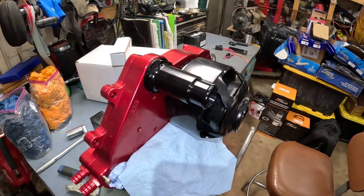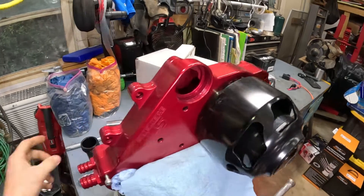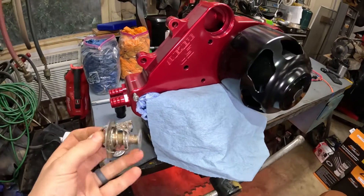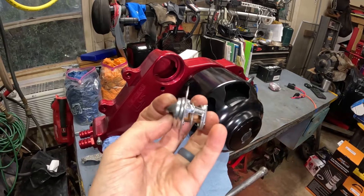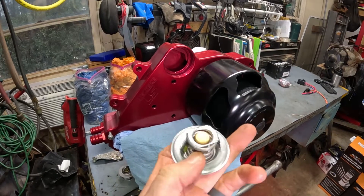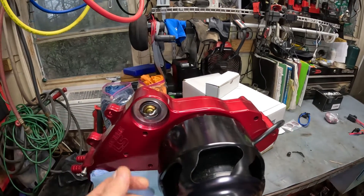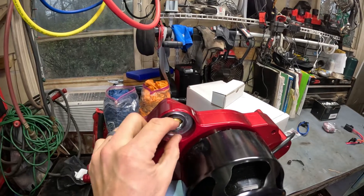Let's move on to checking our thermostat and tightening down this fitting because I can loosen it by hand. We have our outlet hose removed — it has an O-ring and it's a snug fit. We have our standard LS thermostat, which will not work in here. This pump uses a small block Chevy thermostat. The thermostat is a Moto Rad 180 degree — I've heard really good things about them. I'm wondering if that's going to be an issue running our big radiator that already runs really cool in these colder months, but we're going to see.